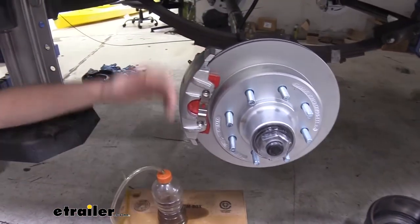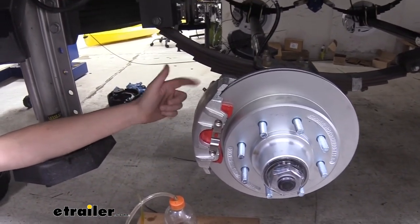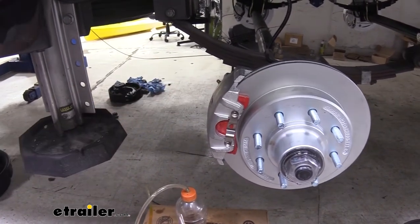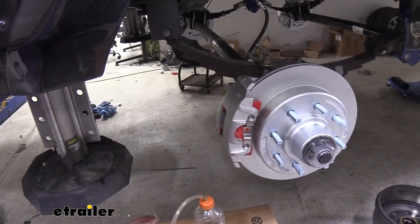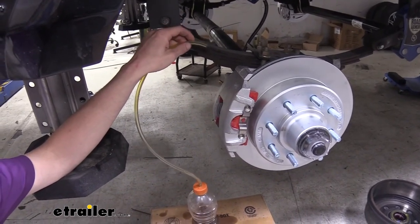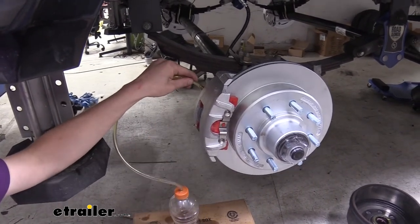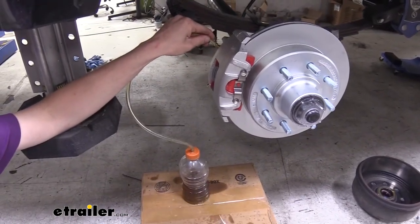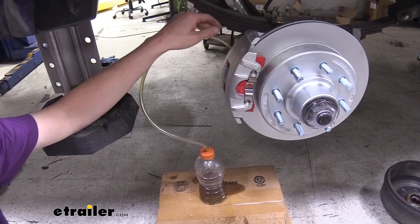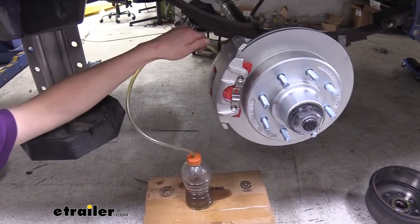Back here at the wheel we've got our tire off and our new systems installed. You've got two sets of bleeder screws on your caliper — make sure you're using the one at the top; you can ignore the one at the bottom. This is going to squirt out with pretty high pressure, so I recommend you have a clear hose so you can see inside to verify if you've got air bubbles or a solid stream coming out — poke that right over the bleeder. You can have the hose go down into any container; we're using an old drinking bottle with a hole drilled in the top, but a pan works fine. Keep in mind the high pressure can cause the hose to whip around in an open pan.